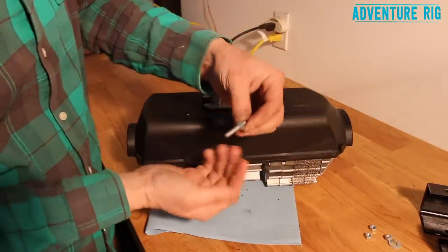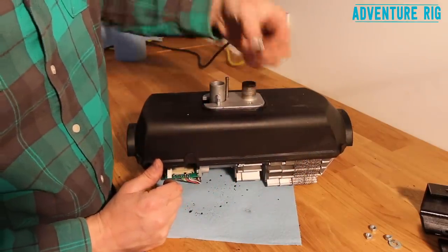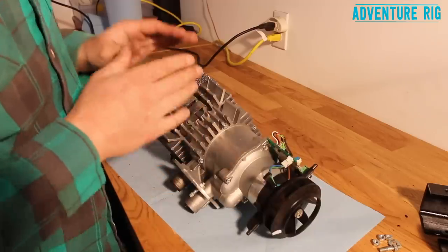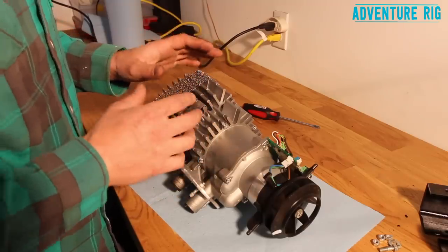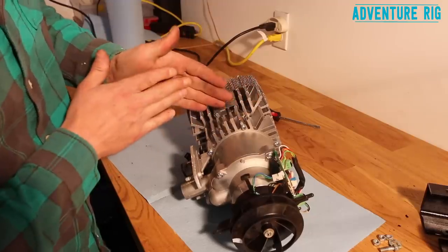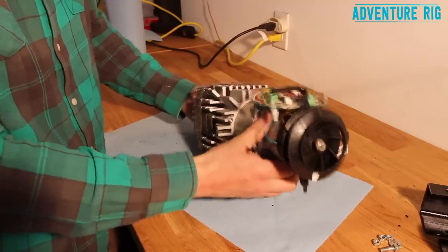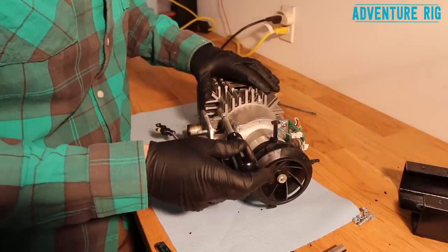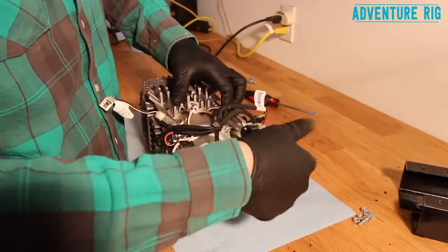On one of these I actually had the entire stud pull out on me — not too big of a deal. Nothing is stripped; the stud came out instead of the nut. I'll have to put that back together. Now into the guts of this thing. If this is as dirty as I think it is, based on what was coming out of my exhaust onto the ground, this is going to be a really dirty job. Now that we have this apart it's pretty easy to get to. We have Torx screws that hold these two halves together — looks like there are five altogether. You can already see the crap that's coming out of here — I better put some gloves on. These are T25. They don't seem too tight. Right when I broke the last one loose I could see these two halves already wanting to split apart.